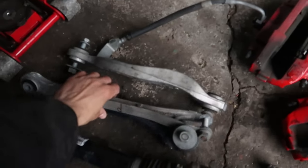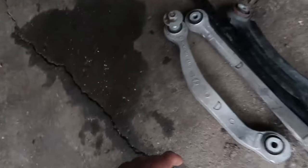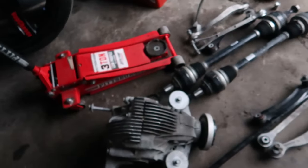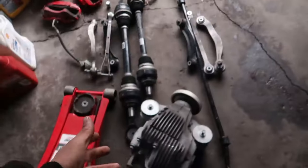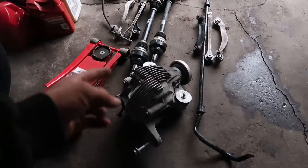If you're smart, I wrote a 'P' on all the passenger-side parts and a 'D' on all the driver-side parts, that way I won't forget. I like to document everything so I know how it all goes back together. We got a nice little 392 diff — that 3.09 LSD right there. It says it on the back side. That's definitely an LSD, 3.09. We're gonna be putting that in the V6.